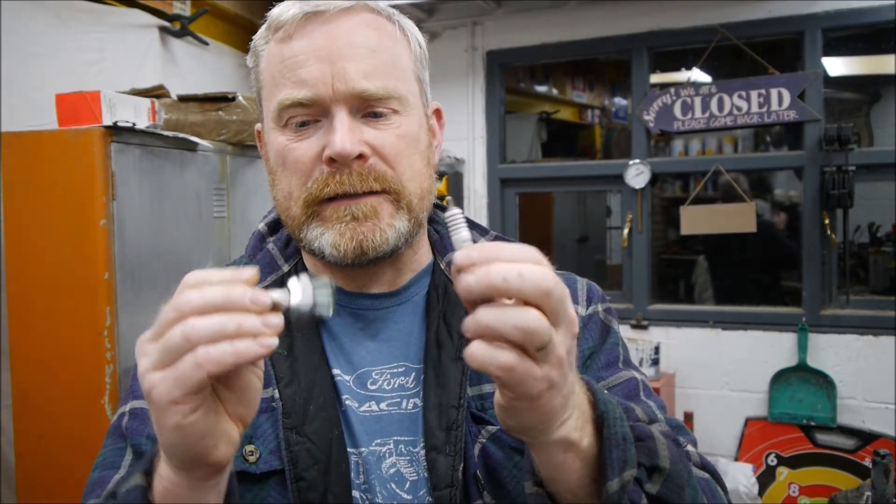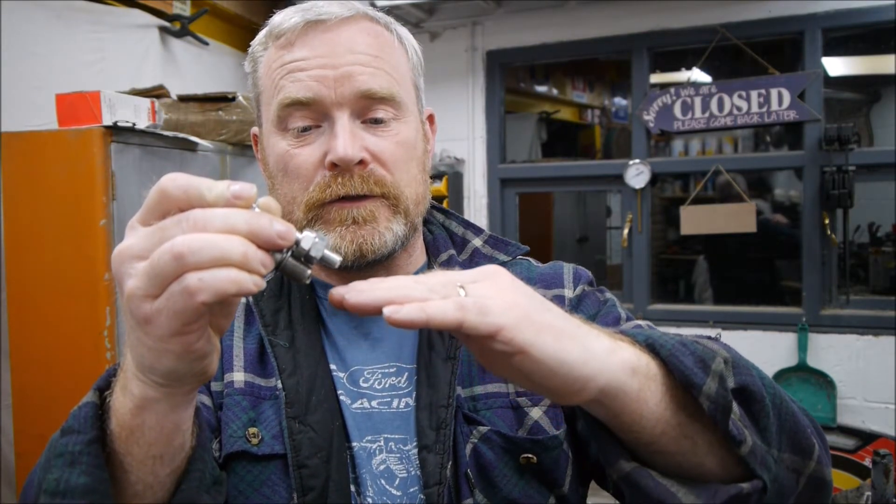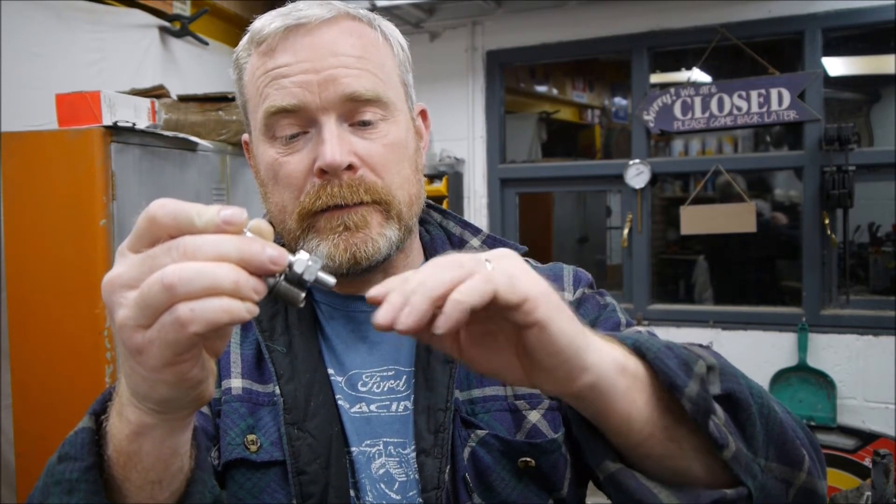How this simply works: you have the screw that comes down through the middle of the spark plug, and you screw it down enough. As a piston comes up, it'll touch the tip of this top dead center indicator and stop at that point. You mark on the crank, then turn the crank the other way and it hits the other side. Put another mark on the line, and in the middle of those two lines is your top dead center. Please remember to take it out before you try starting your engine, because you will put a hole in your piston. I'm warning you now.